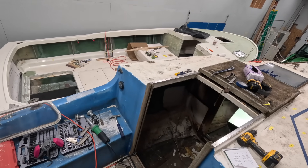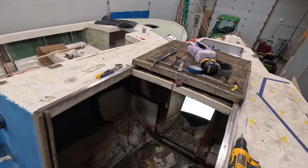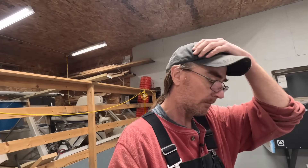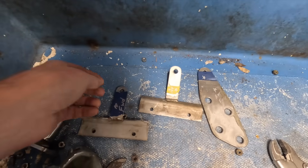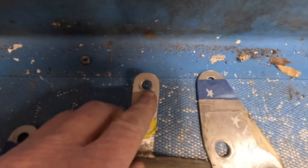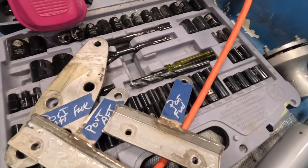Here's where things are at. I got a fair amount done. I was able to get the cleats, the winches, some of the stanchion bases off, the port lights, and a couple of other things. It is about 6, 6:30 on Friday night. The chain plates: overall I think they look like they're in good shape — a little dirty, but all in all pretty good shape. I'm not seeing any indication that this boat had really ever been sailed hard. None of the holes where the rigging came down were wallowed out. I'm not seeing any stress cracks at all on any of these chain plates. These are off the starboard side, and here are the ones off the port side — same condition, nothing wallowed out, everything looks as it should.